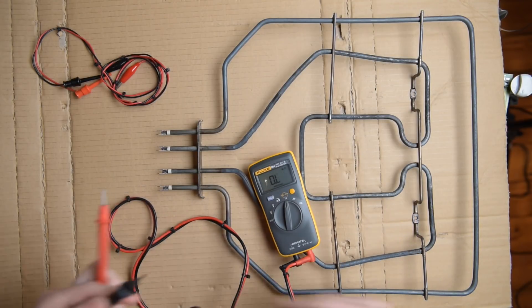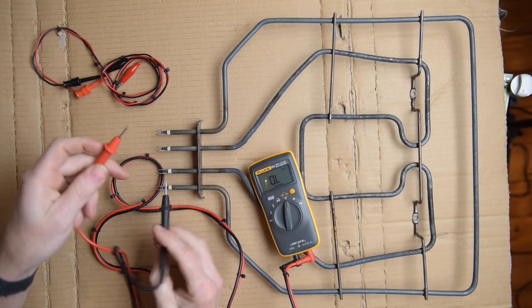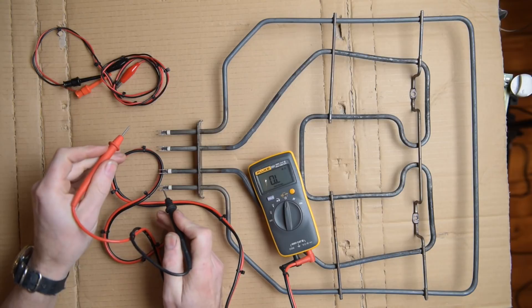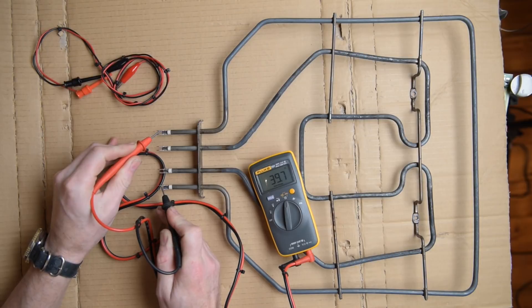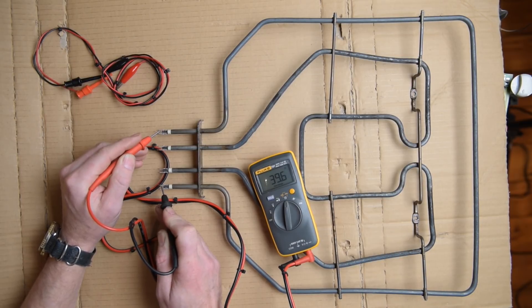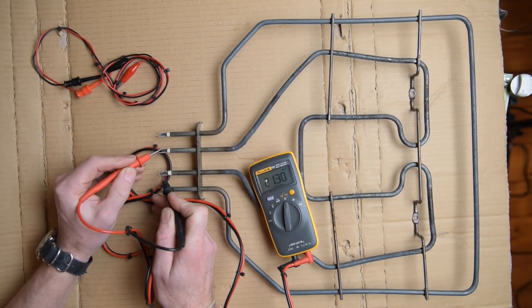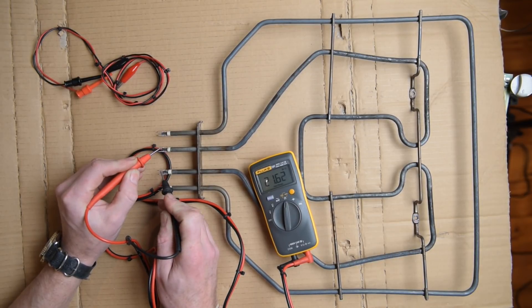To test this, we take the circuit — clearly it's outer ones — and we put the probes on. It doesn't matter which way you put them; there's no right or wrong, as long as it's on ohms. Stick one probe on there and one on there, and you should have a reading. The reading correlates to the wattage of the element. On the video I show that it's within tolerance — I think the new one is 30 to 35.